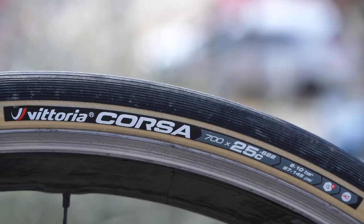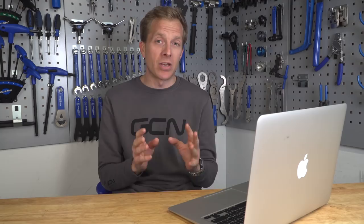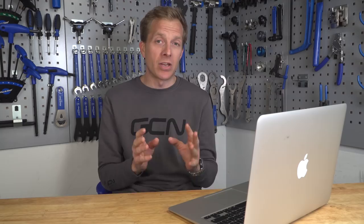Next up, a question from Blair Cabot. Blair wants to know: what are the advantages of skinwall and gumwall tires, or do they just look better? So Blair, those skinwall tires do look pretty cool — whether or not they look better, that's for everybody to decide themselves. Traditionally, those tires were basically more supple than a nylon sidewall tire. The reason being you can have more threads per inch, so if there's a rock in the road and you hit it, you're going to go over it a lot better than with a very rigid sidewall, where you're just going to hit it and probably puncture.